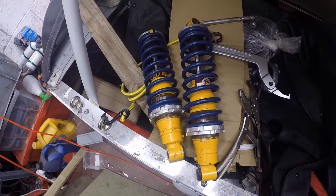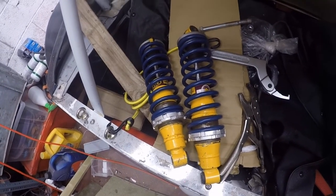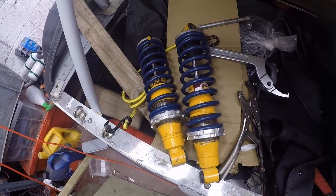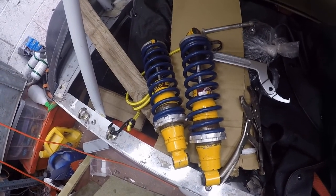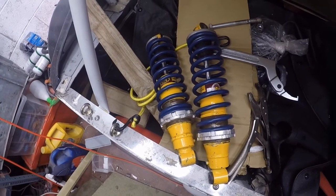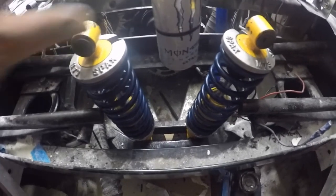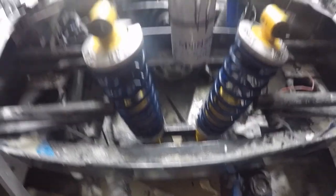So there we have it - both the shocks are now built back up. There's about 16 ticks of adjustment on the damping so we've gone nine clicks from full hard. I reckon that would be about right to get us started. We might then take a few more clicks out towards soft but we'll see how they go on those settings. Next job is to get these back in the car - just need to find all the bolts and nuts to do that with. But before we do that I'm going to go and have something to eat, so that's me done for tonight. I've ordered some spring compressors so I can actually get these into the top mounts, but they're in at the bottom mounts and good to go.